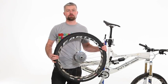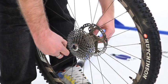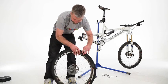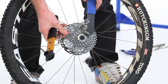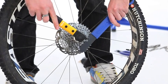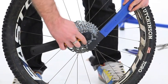To take the wheel out we need a couple of tools to remove the cassette. With the wheel out we can get on with removing the cassette. Spin off the quick release if you've got one fitted, and put the spring and the nut back on the end so you don't lose them. We need to hold the cassette still with a chain whip and then we need a cassette lock ring tool to undo the lock ring. It's probably quite tight — it should be if they've been done up properly.